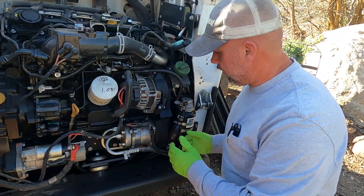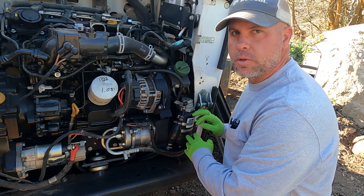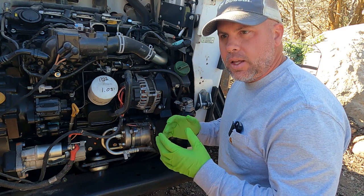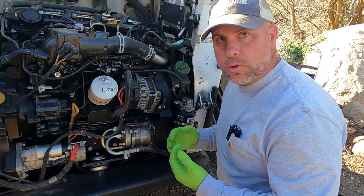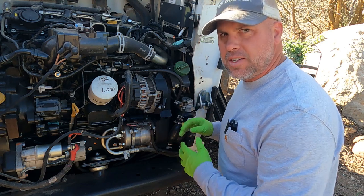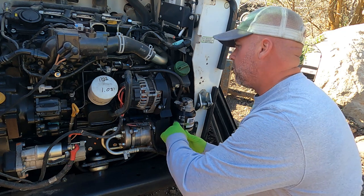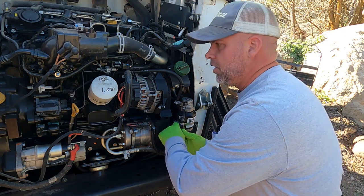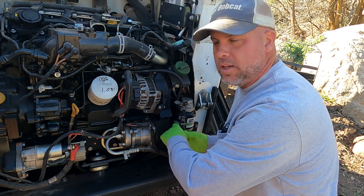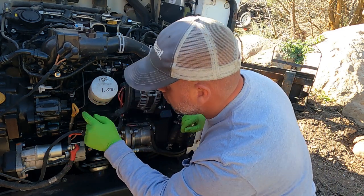The first thing I want to do is actually make sure I have fuel to the fuel filter. The fuel filter looks fairly new — it is the new style filter, so I don't necessarily think that this filter is clogged up. If I had a low rail pressure code while the engine was running, I would go straight to the fuel filter, but since it's a no-start condition, I don't think it's the fuel filter. I'm going to squeeze the primer bulb and see if I can tell if I'm getting fuel through there — and yes, I am getting fuel through there. The primer bulb is getting firm, which tells me I've got fuel all the way to my injection pump.